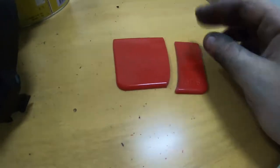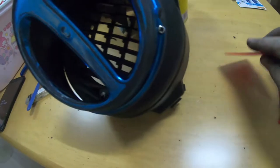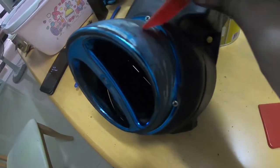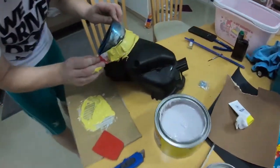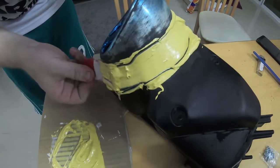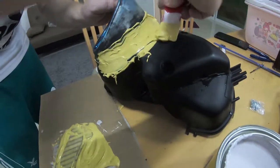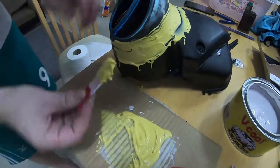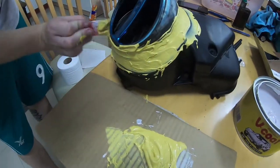First, I just wanted to show you what I've done with this body filler spreader. It's quite big and I've only got a small space to work on, so I'll use that one for mixing but this smaller one is perfect for getting the correct edge, covering the screws, and making sure it looks super smooth and like a one piece unit. Here I am applying the putty — it's a really good consistency, mixes really easily. Maybe doing it indoors wasn't the best thing; it smells out the whole room. I'm being quite liberal when applying the putty because it can all be sanded off afterwards. I think once I've got the correct amount of filler, get it sanded down and ready for painting, it's going to look fantastic.